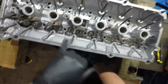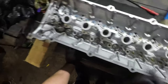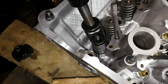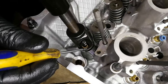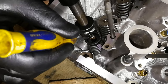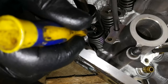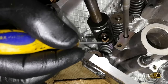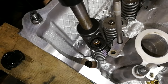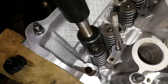You can see I've got my Super Tech valve stem seals — brown for the intake and blue for the exhaust. I'm going to continue doing these valves and show you what it looks like when all the valves are in at the end. One more thing I've learned as I've been going along: if you get the keeper nice and stable, you can go directly in there and bang it straight against the valve. Instead of going from behind, just rotate the keeper around — the grease keeps it in place. Drag it around gently, then put the next one on exactly the same way. Just gently pop them in, loosen them off as the spring comes back, give it a little wiggle just to make sure it seats properly.